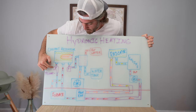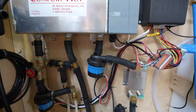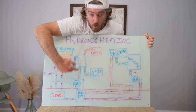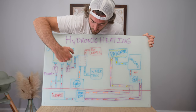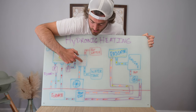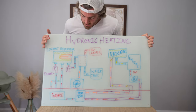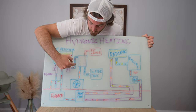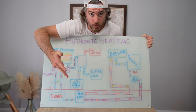These purple elements in the diagram are pumps — that's how we circulate coolant through the lines both for the floor loop and for the coolant loop serving the hot water and hot air heat exchangers. Once the coolant is hot, we have hot air, hot water, and hot floors. The key to the whole system is heating up that coolant.